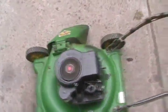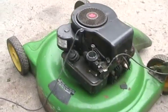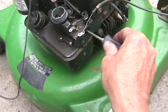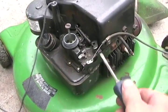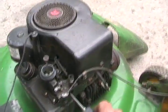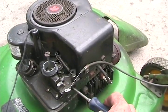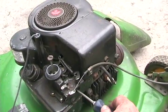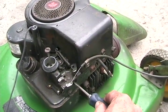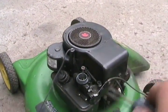It's all open and it sounds like it's running a bit rich, so we have the mixture adjustment screw here. If your lawn mower started and ran for a couple seconds and died every time, stick your flathead screwdriver in and turn the screw back half a turn and try again. If it still does the same thing, turn it back a bit more. When you do get it running, set it to full speed and rotate the screw until it starts to chug and puff black smoke, then slowly rotate it clockwise again until the engine smooths out and runs perfectly. If you keep turning it too far, it will run lean and stall in the grass. Rotate it back to just the point where it starts to chug, then go a quarter to an eighth of a turn further — that's the perfect range. If it starts and stalls next time, turn it back one-eighth of a turn counter-clockwise.